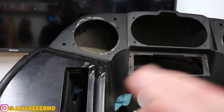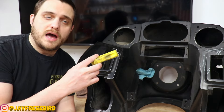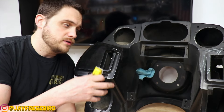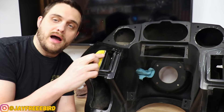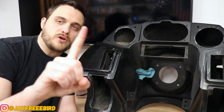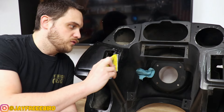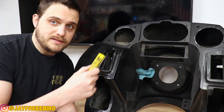Let's get this sanded and see what it looks like, then we'll get to the other part of this fairing. The step process I used on the right-hand side: this little pad kit you can buy at auto parts stores or hardware stores. This is an 80 grit, we'll go to 120 grit and 220. I really like using these because it gives a perfect grip for your hand in tight spots. You can get nice and flat without a big piece of sandpaper or using one finger, which causes highs and lows. This kind of eliminates that — lets it go flat right on the plastic and move around the corner. Let's get to sanding.